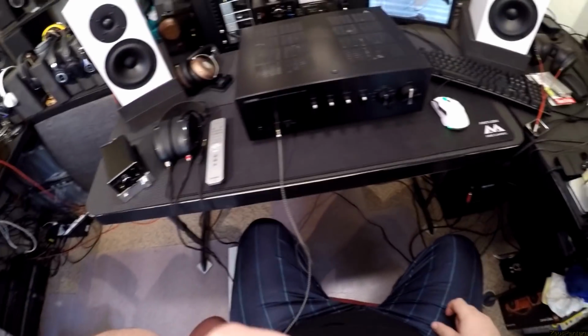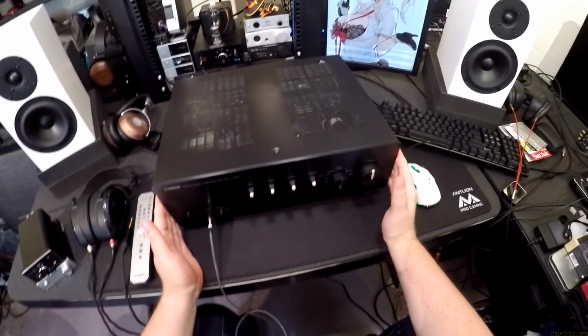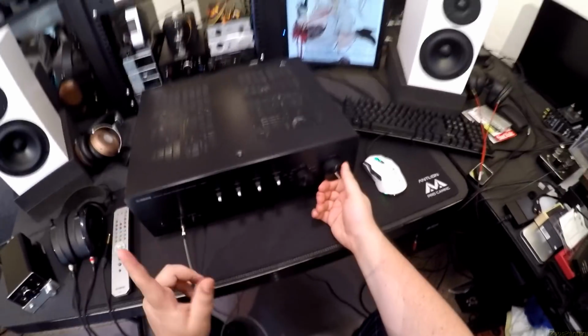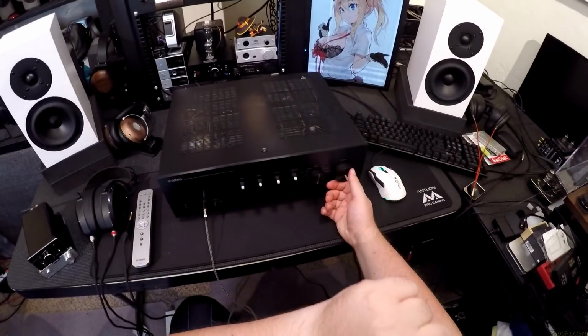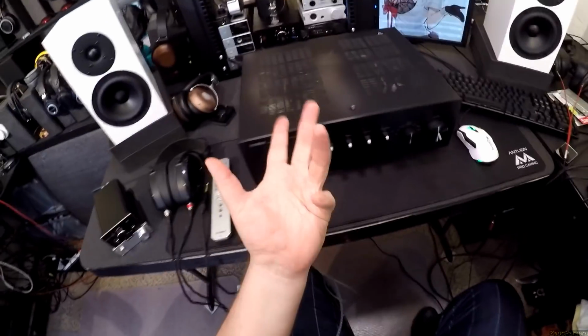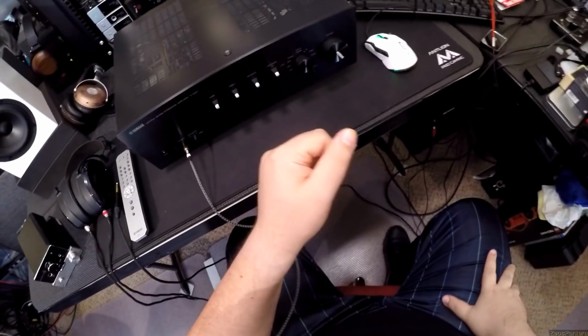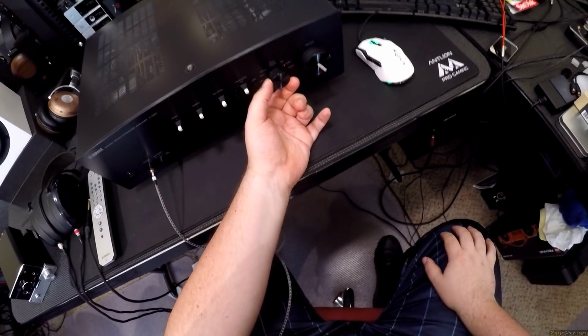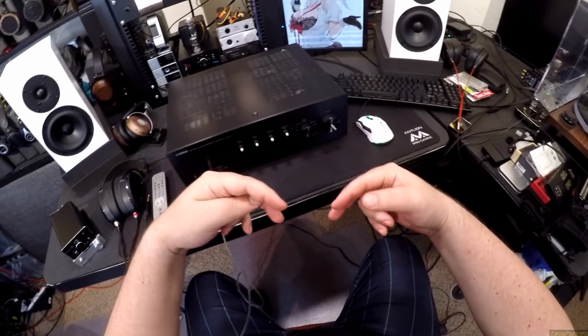Okay, so you want to know, the quality of this amp is good as far as everyone's concerned except for me. Because I'm on a tuner, which is not plugged in, or I'm on CD, which is not plugged in. And if I go to tuner and turn the volume all the way up, Billy Joel is playing from my computer. So the analog input from Billy Joel is leaking into mostly the left channel. If I switch to CD, now Billy Joel is far right, and there's birds chirping from the vinyl. So these unused inputs, the digital input's not going to have anything happening. But CD and tuner are leaking other analog inputs into this, and I could hear it. And that's just bad separation of signal sources.